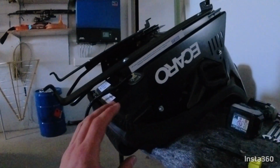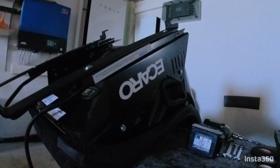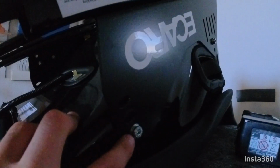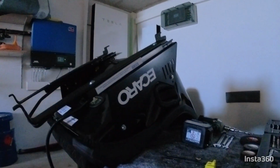Anyway, what I did is, you can buy those seats and get those seat consoles, so those sheet metals that are attached here, you can buy them from Recaro. They are matched to those seats. You have them adjustable in the front and rear. There you go, so you can see those 4 slots here. You've got 4 in the front, 2 in the back. So you can alter the angle of the seat, how you sit in the car.